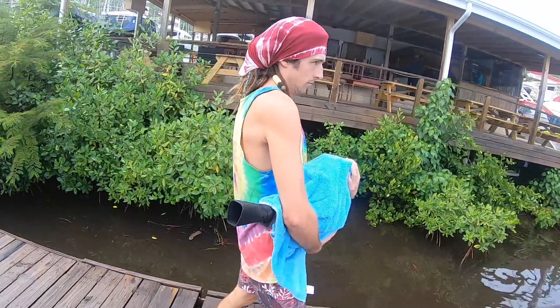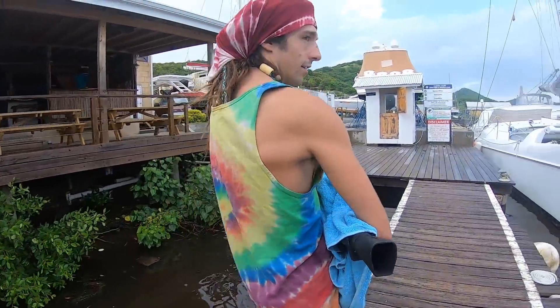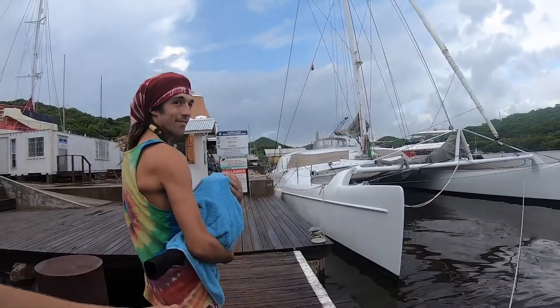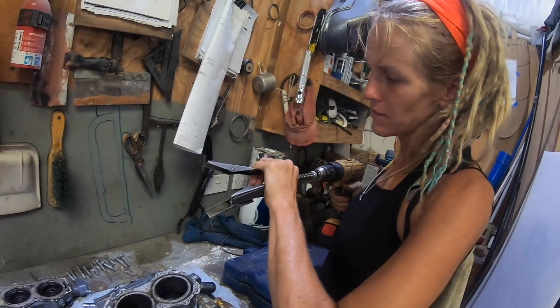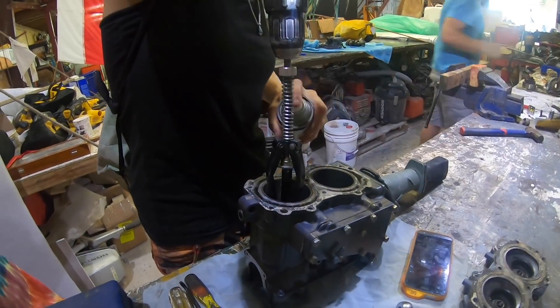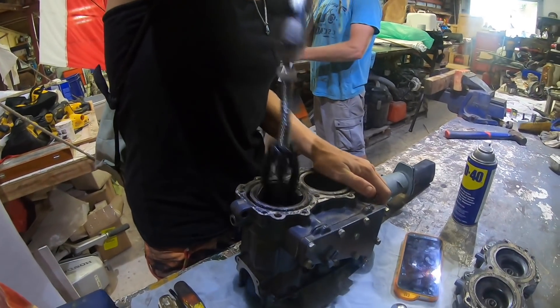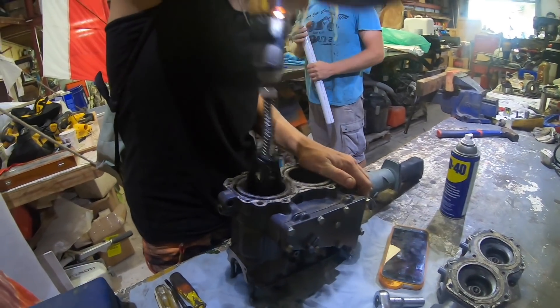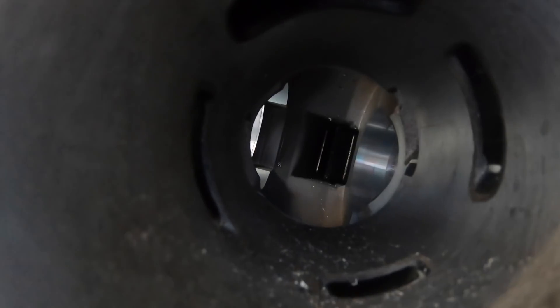We're taking our little bundle of joy up to see a friend for some soft honing. I phoned a friend to borrow a honing tool — highly recommended if you're this far into an engine. The stones on this tool provide an even surface that actually sand the inside of the cylinder. The up and down motion is to crisscross your sanding strokes at 45 degree angles.